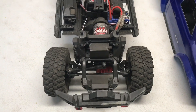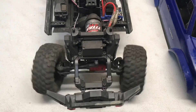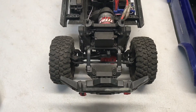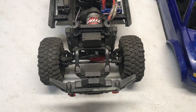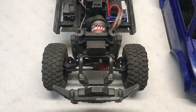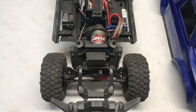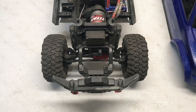This is the 2075x box stock truck. Although it looks pretty good, if you guys have this truck, you know this servo will stall quite easily in the rocks. Let's go ahead and get the 400-ounce servo in, and I'm going to put it in without the BEC first just to see if I can get the ESC to brown out. Probably not on the table, but I'm pretty sure it would out in the rocks.